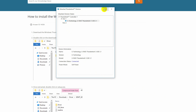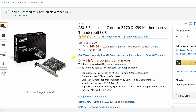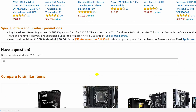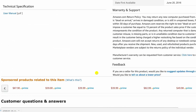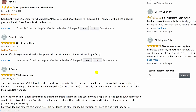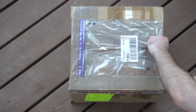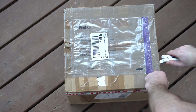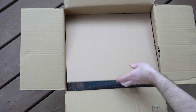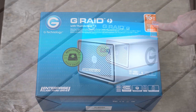With our main machine, based on an ASUS X99 motherboard requiring an add-on card for Thunderbolt 3, our experience was actually much worse. Despite countless hours of hardware and software changes, forum tips, and even emails to ASUS, we were still unable to make this card work. Bottom line: if you have a Windows PC which did not come pre-configured to handle Thunderbolt 3 out of the box, be prepared for some potential deep troubleshooting. We really wanted this to be more of a plug-and-play experience just like USB, but that isn't the case from our experience.